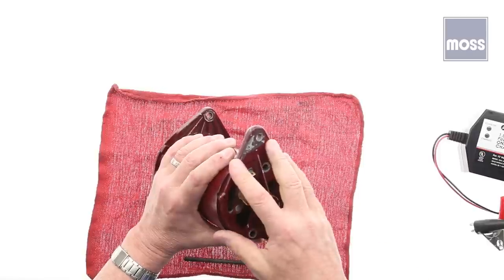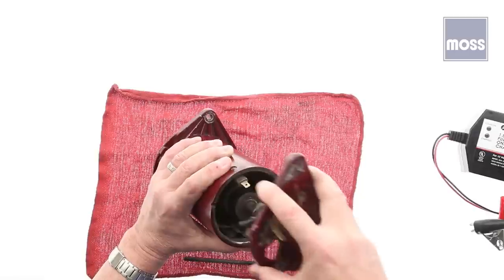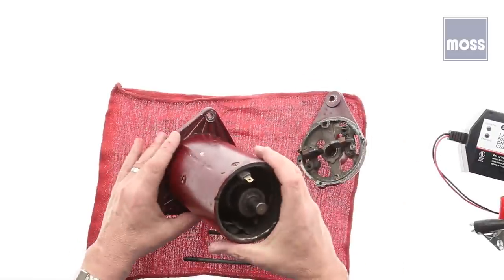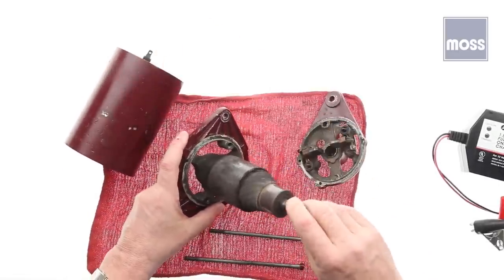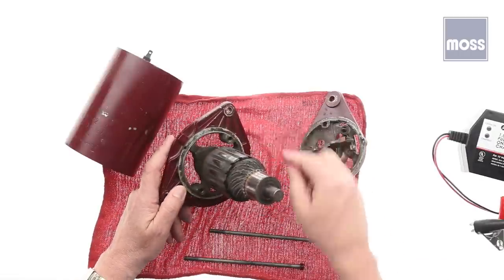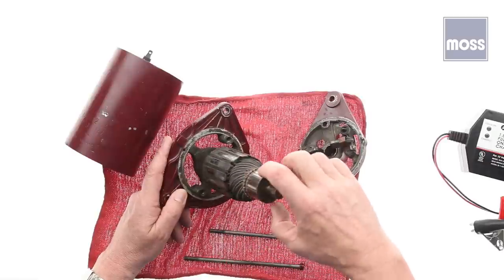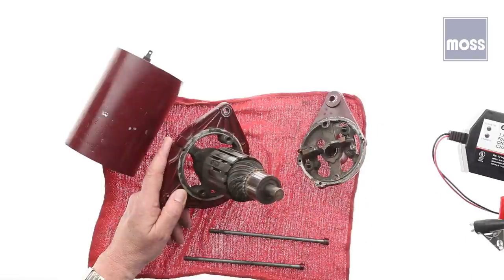This end piece here is the end plate — the brushes are inside. The brushes are spring-loaded; if you listen, you'll probably hear them pop out. There are your two brushes right there. They sit and ride on the armature, on the bars in the armature. This is the armature — the part that spins. While this is working, it's trying to make electricity. These windings around the middle are the current-generating windings. The electricity is formed in here, travels up through these spiral wires, each one soldered to one of these bars. The brushes ride on the bars, pick up the current, and carry it off to the car. That's how the system works.